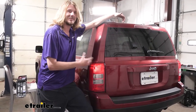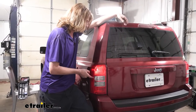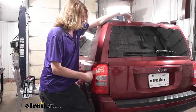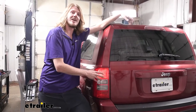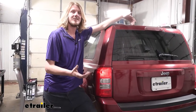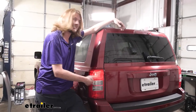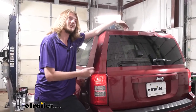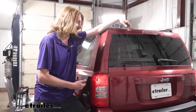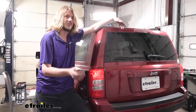The other options for getting lighting set up that don't include diodes are bulb and socket, where you would physically drill a hole into the lighting assembly and add another bulb. That works okay on some of these older vehicles like the Patriot here, where you have enough room inside the assembly to add a bulb, but on many of the modern vehicles today that are LED, you just don't have the space. I also don't like that option because once you drill a hole into this assembly, you have to seal it back up for that new bulb, and if you don't seal it up properly, you're going to get moisture in here, which can fail safety inspections in some states and cause further damage to the bulb and wiring inside your assembly.